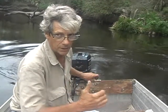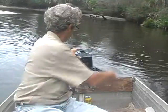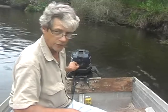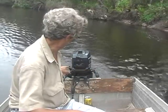That sudden change kind of affected the mixture a little bit. Let it sit here for a minute. This is the choke, but it's also the fuel shutoff I was talking about in the ad. Don't try to turn it. That's a holdover from when the tanks were built in up here, and it was a gravity feed. You had to be able to shut the fuel off to the carburetor. Well, in your fuel connection, first off, this has a pump. Secondly, your fuel connection has a check valve in it. So when you unhook this, the fuel can't get away.